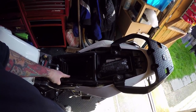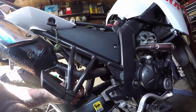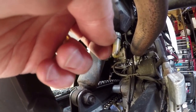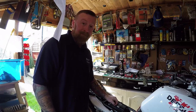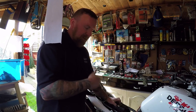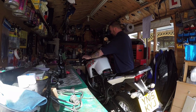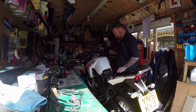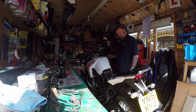Air filter is under the seat - simple as that. It just plops on there. Handy tip: when you come to this side of the bike, in here you see this? This is for any detritus - any bits of rubbish or oil - it fills this up. When doing a service, take this off and check it. This one was full of oil, picking up bits of crap and chucking it into the back of the air filter.